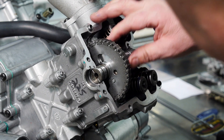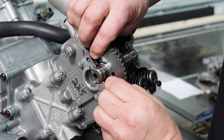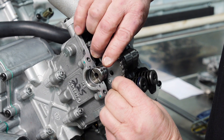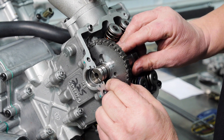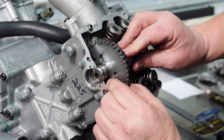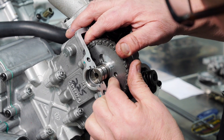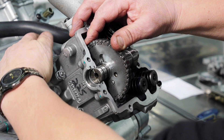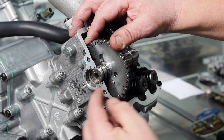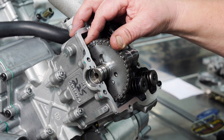I know that I'm just off one tooth. Be aware that this pin can come out. Now you see the pressure back because our tensioner is back here. I'm going to pull it tight on the front side, and now our camshaft is perfectly aligned with the top of the cylinder head.